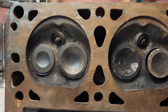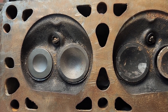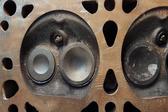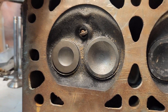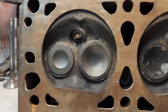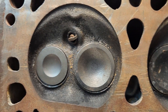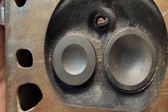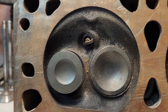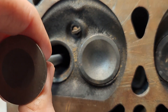This is a 1983 cylinder head — it's what they call the low output version. The HO versions had a bigger exhaust valve and I believe a bigger intake valve as well. These ones here have a 1.6 intake valve and a 1.307 exhaust valve. Funny story — I could not find the exhaust valve I had from this head, so I used a 260 valve here which is 1.300, so it's a little smaller but it works for flow testing.